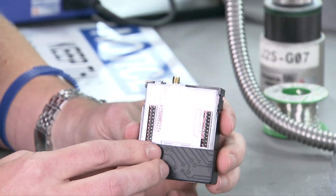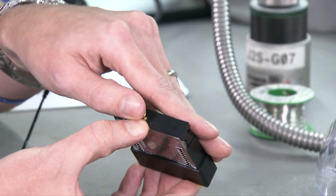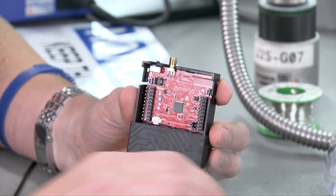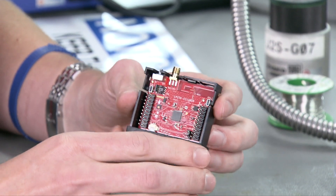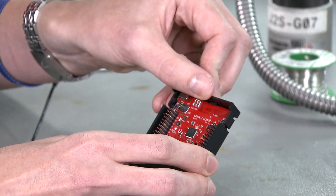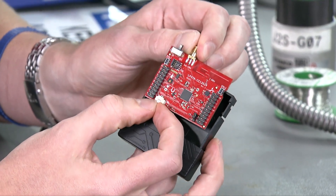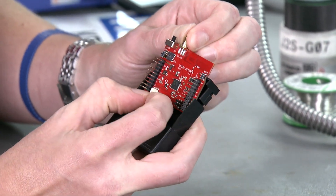Then there's a clear piece of plastic that needs to be removed. You can remove it by pushing down on the top just in front of the antenna and gently pulling towards you to separate, and it comes right out. Finally, for the PCB, there are three retaining clips in the black plastic that hold the PCB into place, so you'll need to gently pull away on the top piece of black plastic and at the same time push forwards on the PCB and it pops right out. Then grab the battery connector by the white plastic instead of the wires and gently separate it by pulling down.